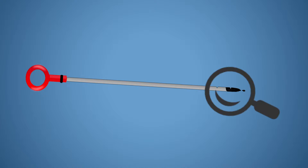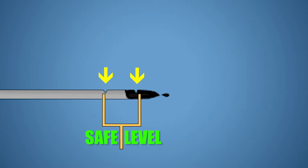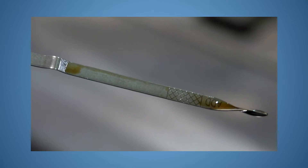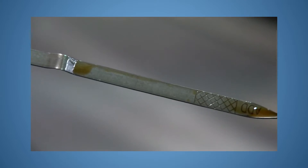Now you want to look for the two lines or holes at the end of the stick. If you see that the oily and the dry sections of the stick meet in between these lines or holes, then your oil level is safe. If the oil level is showing below the line at the end of the stick, then you will need to add oil.